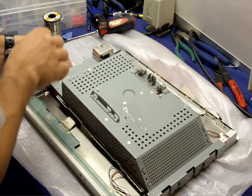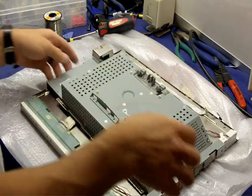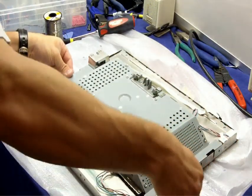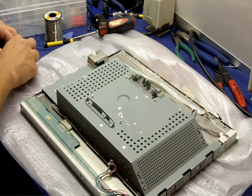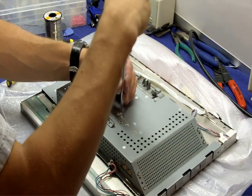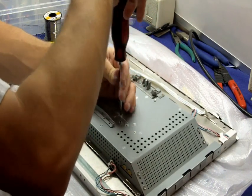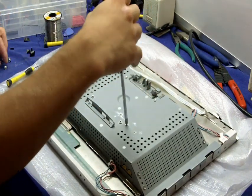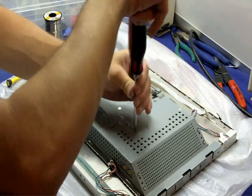I put this ribbon cable back in with screwdrivers as well because the tabs are so small — they just grab it real nicely, whereas using my hands I'm afraid I'll bend the cable. Don't smash your pink and blue wires with the chassis — make sure they're out of the way. The blue wires go to the outside on both top and bottom, and the pink wire goes towards the inside. I like to get the screws with the thermal compound in right away because they're messy and sticky and get everywhere.